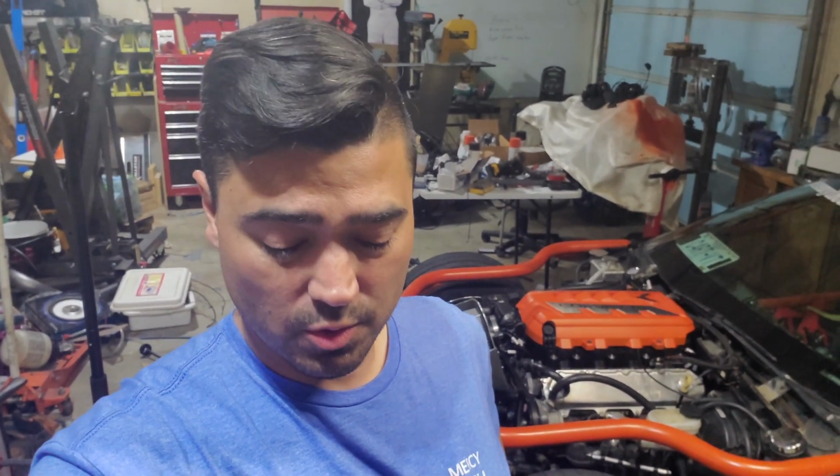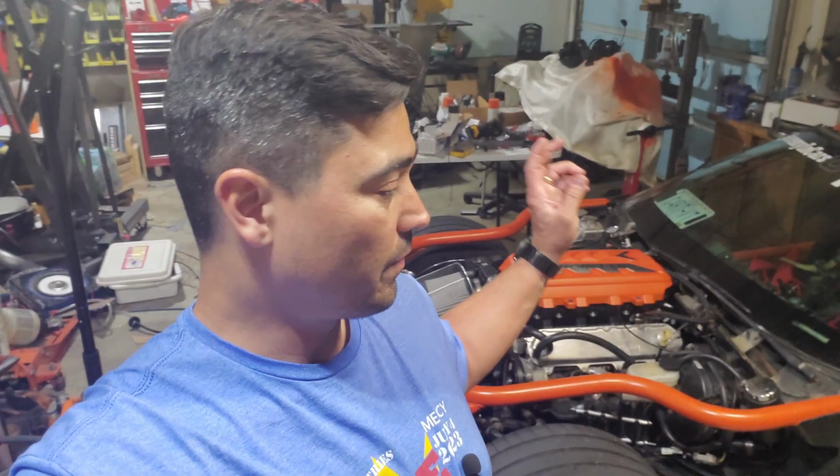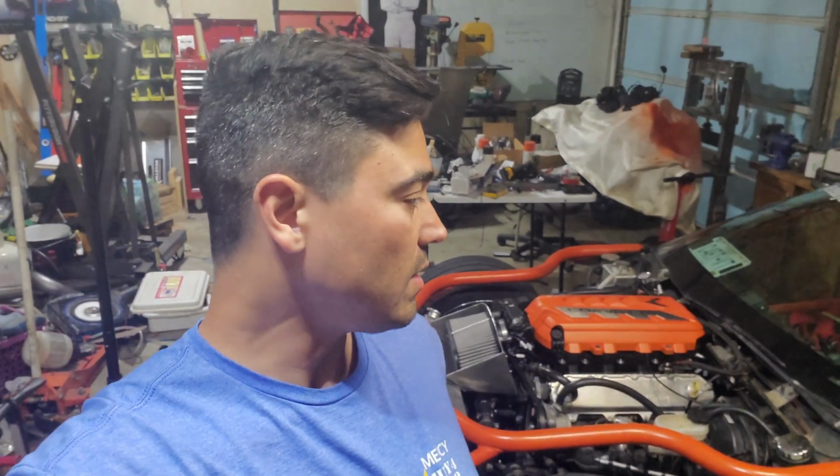And there was a guy there who knew a decent amount, had installed dozens of Holley systems, and so we kind of talked it over a little bit. Basically did a reset on the TPS, not the Wizard TPS, although I did do that later, but kind of a throttle clear. Basically, you hold the foot to the floor and you turn the Holley on, and then you try and start it. So it seemed happy.